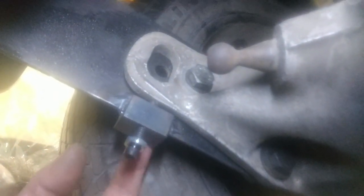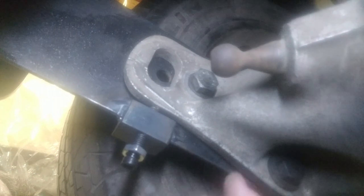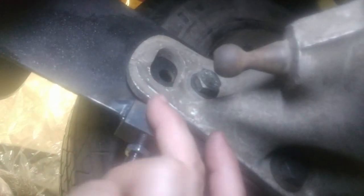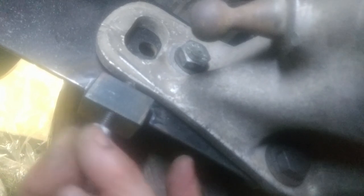I'll do my best to explain how this new block and threaded rod work. This is from the inside of the trailing arm — this banana arm is aluminum. What happens with this adjustment block is it pushes up against the aluminum trailing arm and changes its position relative to the spring plate. The procedure would be to loosen these three bolts — there's a big M12 bolt there, one there, and one up above the banana arm, situated in a triangular pattern. When those are loose, you can force the arm up or down depending on how the adjustment bolt is set, and that changes the camber. This is where the eccentric bolt normally goes — it does the same thing, just changes the position of the arm relative to the spring plate.